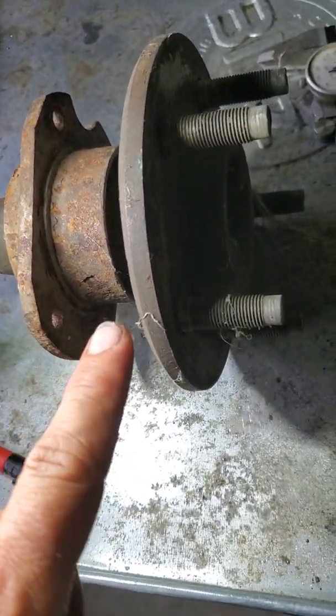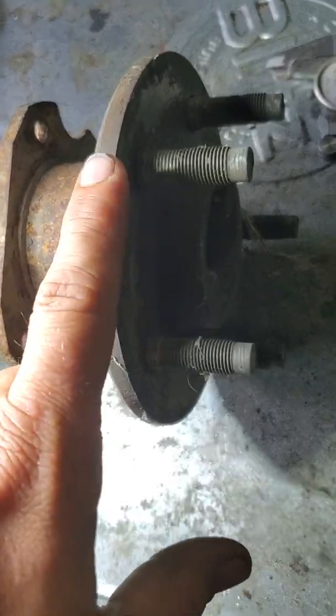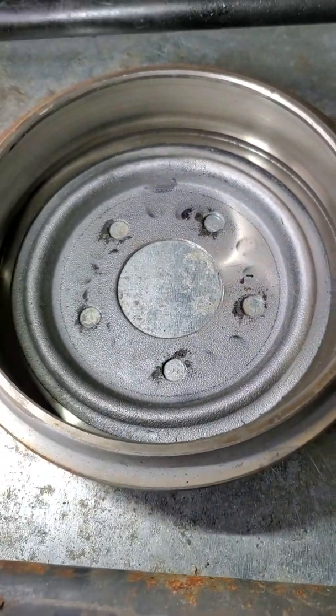To minimize how much we had to turn down the axle, we cut a generous chamfer off of this corner here, and that lets the axle set down in that radius a little bit better.